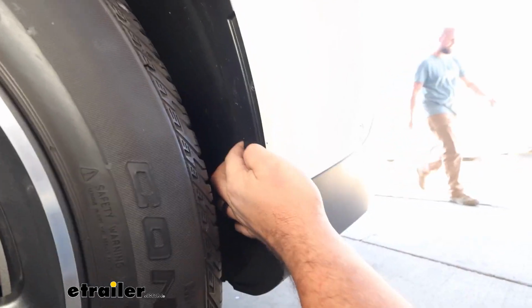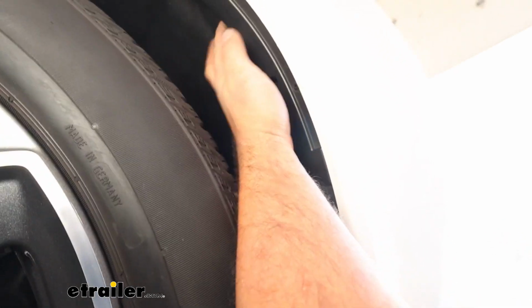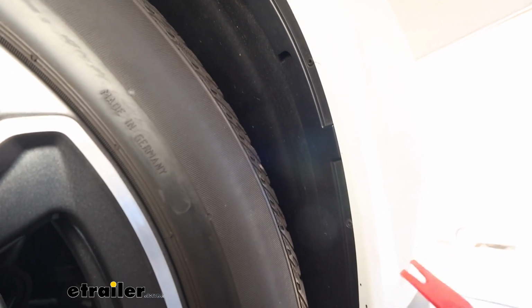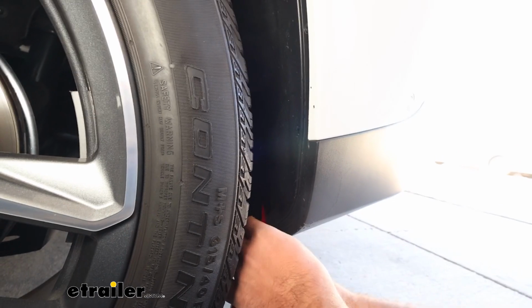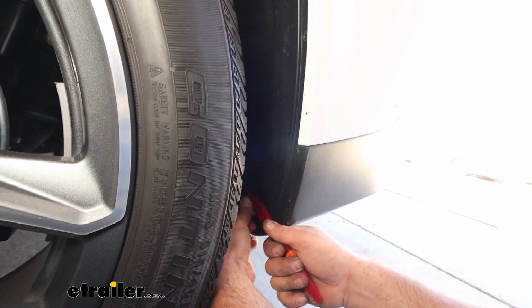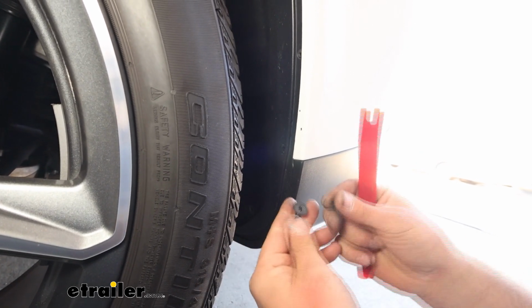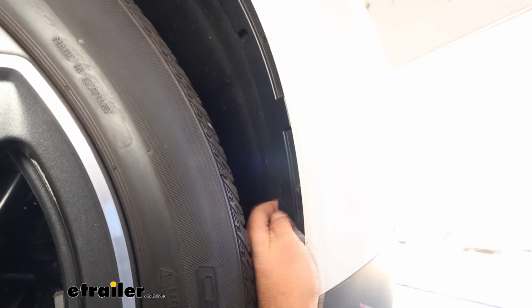And then there's going to be 3 plastic push pins. So there's one here, and as you work your way up, there's one kind of tucked behind this plastic right here, and then there's going to be one more as we work up right here. Now, they're very small, and so use a plastic trim tool like this; they recommend the 90-degree pick. These are not exactly easy to pop out, but what you're going to do is wedge on that center button and try to get a gap under there, and if you can pry that center out, it should remove it. I did have issues a little bit with it just rolling the edges of it, so get a good bite on it, and then as you pry out, you should be able to get the whole thing out. If it separates like it just did, just make sure you have both of the pieces, and keep those contained. So work on those 3, and then there's going to be one more bolt that we're going to need to gain access to.